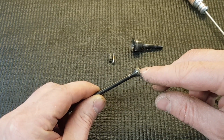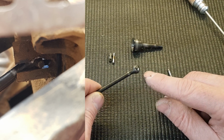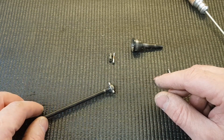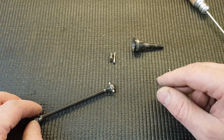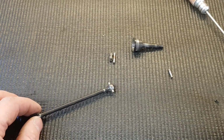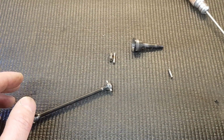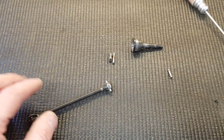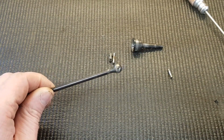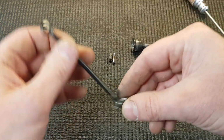If this has started to wear, I would replace it, because the problem that you will have is your drive cups start to get a groove in them. Now I've got a picture here of the ones on this car, and as you can see there is actually a groove starting to wear on it. So we are probably going to have to replace the drive cups. The pin seems okay, but I may replace the pin as well. It will affect the truck because the drive shaft cannot move up and down the drive cup as freely. So that's your first part to look at.